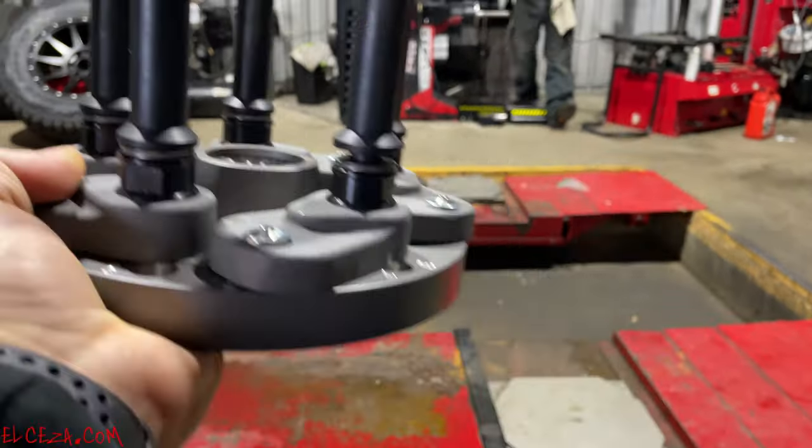Take it out too. You've got too much in. So if you end up having to put, you know, 40 pounds of air over here to get the bead to seat, don't worry about trying to get it back down. Bring it over here, set it where you need to be, and the machine's moving stuff.